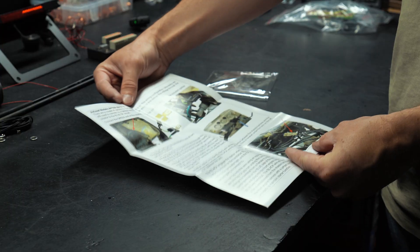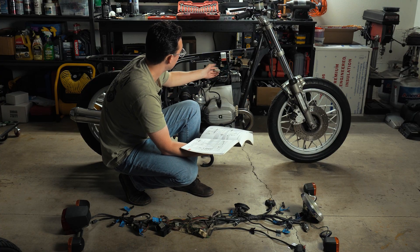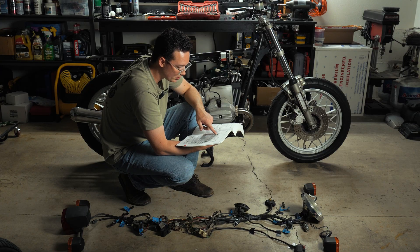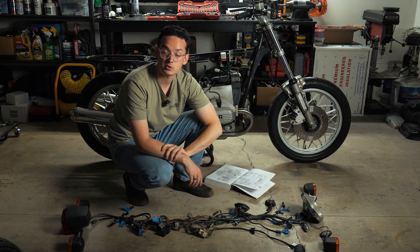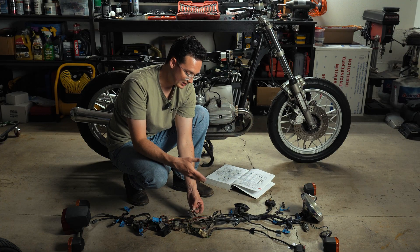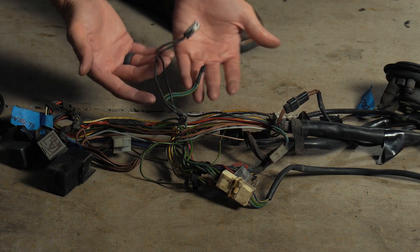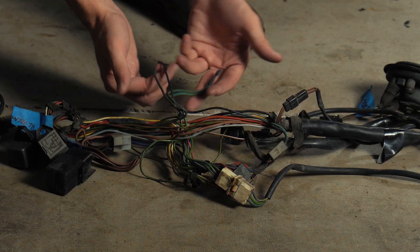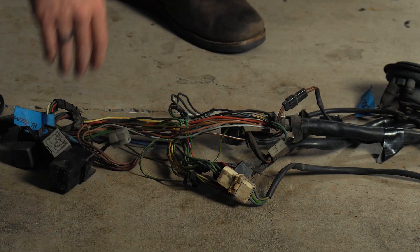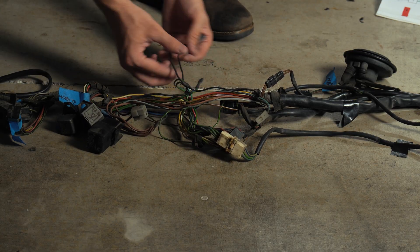The new wire doesn't go in the black terminal — it goes in the green terminal. One green wire goes to the ignition control unit, so I need to make sure that wire ends up there. The other green wire runs up to the emergency stop switch, which gives power to the coils or cuts it when you need to kill the bike. For that wire, we're going to cut it and note that it needs to be 12-volt switched power integrating into the MoUnit. If that feels confusing, remember you have the physical wiring in front of you — you can follow the wires to their switches and see how they reconnect, and go back to the old-fashioned physical method to check your work.